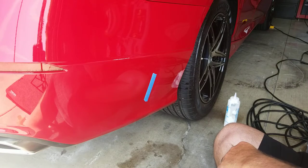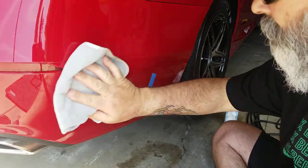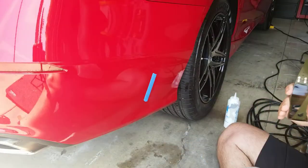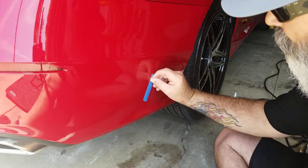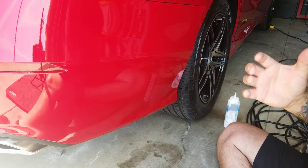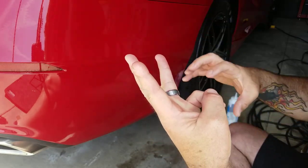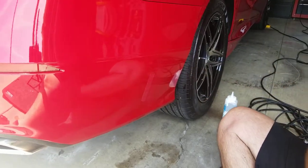Okay, let's check it out. I think it did the trick — just that little bit of work. Wow. So let's take this off. I think I went over the tape line — you're going to see a little bit of polish over the tape line. I know this isn't just the Bauer machine that made this happen — it was the pad and the excellent polish that I chose, right? The ceramics heavy cutting pad by Lake Country, plus the big throw machine. That's impressive. That's crazy right there. For $120 bucks, I'm so happy that I bought that machine. Holy crap. See the sanding mark — here's the line of demarcation as they all say. See the 2000 sanding? This is where the tape was. And that's the nice looking reflection now. Ba-bam!